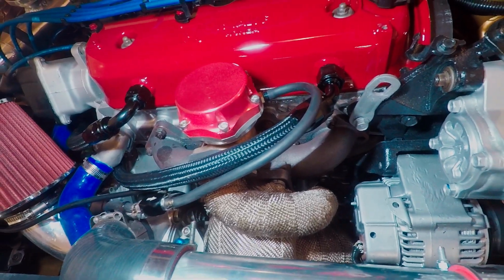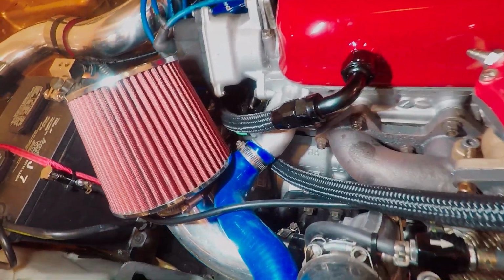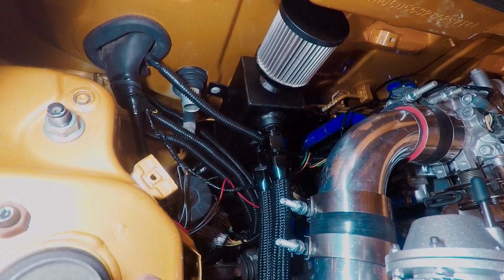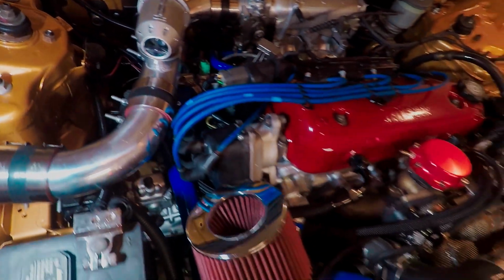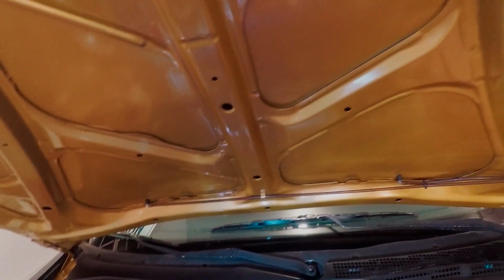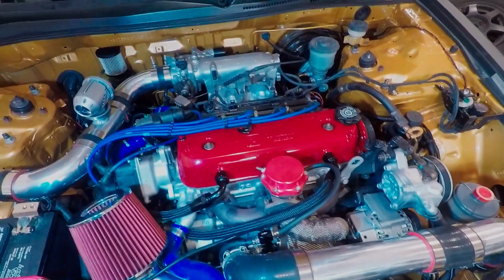I did make that other one, ended up being a 45, and I think I have it spaced away enough from the downpipe and the actual wastegate, or the wastegate dump rather, that I won't have any issues burning. One line went under and one line went over the coolant hose there, but they run back here, not touching the linkage or anything, and then they go over into my vented catch can. There is a drain on the bottom of the catch can. I think I snugged that up prior. But hopefully we don't get any oil coming out, because that's not the idea here. I just want to vent the crankcase vapors, and we did have an excess amount of crankcase vapor, and I don't want it to spray all over the underside of my hood. So I think we'll be good to go with that. This is just going to keep the engine bay clean and make sure that we can get rid of any crankcase pressure that we need to get rid of.